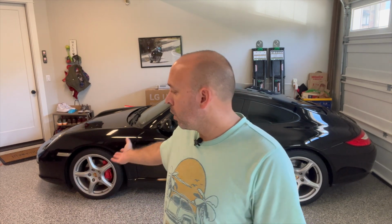And when they took that sway bar out of that BMW, it was where the bushings were, it was completely corroded because moisture and stuff would get inside the bushings and couldn't escape. The rear sway bar on this car is exposed. And I think that's probably why it's not corroded, is because whatever does get on there can fall out. I don't know. We're gonna investigate this. Maybe when we change the spark plugs, maybe we'll just stick a camera up there and look, because we'll have the car up on the quick jacks.